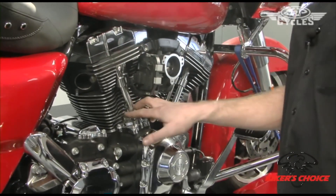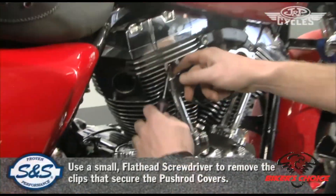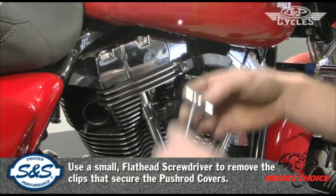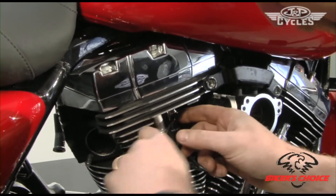What we do is use a bolt cutter, lift these push rod tubes, and cut them. There's a retaining clip at the top of the push rod — you just stick a screwdriver in the little slot and pry it out. Remove all four of them — there are two in the front and two in the rear.